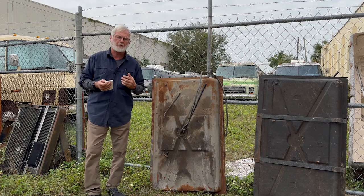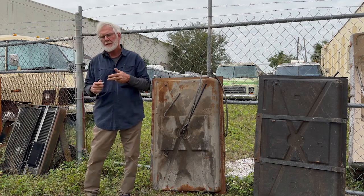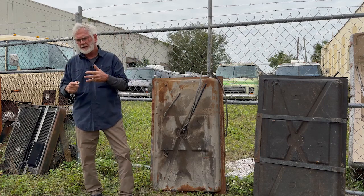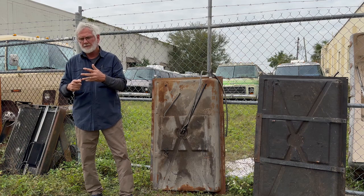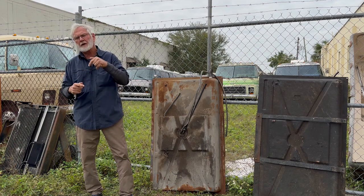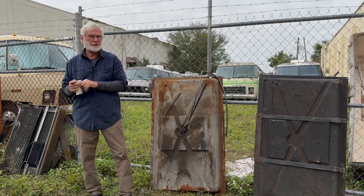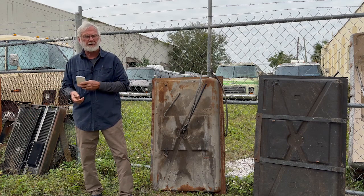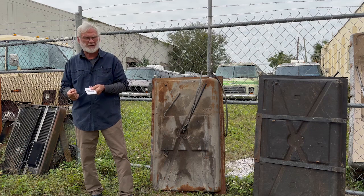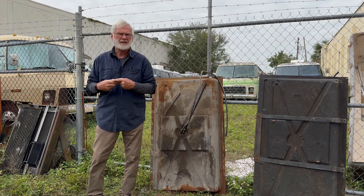Those kind of motors are not what we want. We want a motor that runs on low compression gas, right? We want a motor that does not get hot, that you have a fuel injection in it, okay, that creates most of its torque at low RPM. Okay? We don't want a race motor. But if that's what you've got, lean it out, drive it right, drive with your vacuum. Stay above 10 inches of vacuum. You can stay above 10 inches of vacuum, you can save money in fuel, and chances are you won't burn something up.